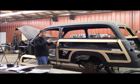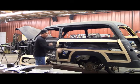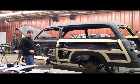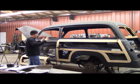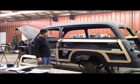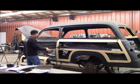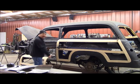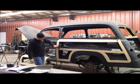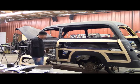And you've got to be able to locate this piece, start right here, install it, then install the window, then install the door. But they're all kind of tied together, so I'm fitting all of them and seeing where they're at, and then working them all back together. Now this piece right here I know is a little high in the front. It's showing up when I put this piece on. I got a big gap here, small gap down here. I've got to have a consistent gap because I can't take it off of this, or it's going to make this piece look out of whack. It's got to be consistent.